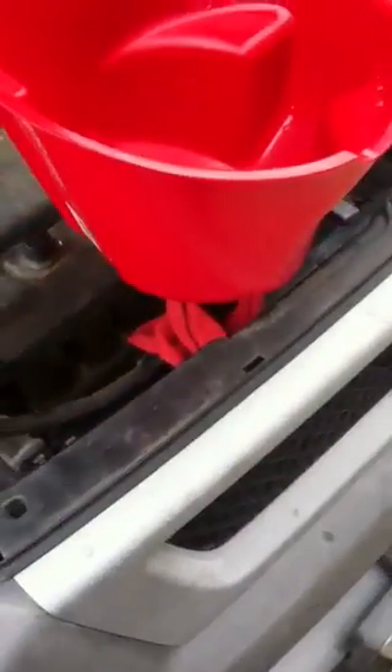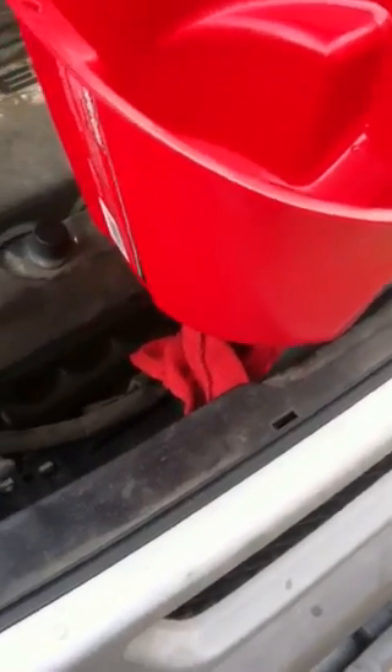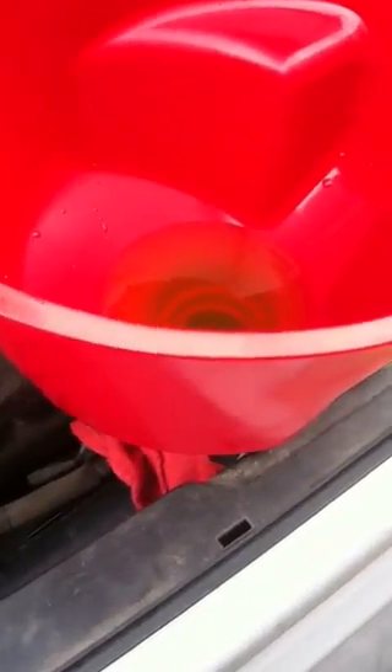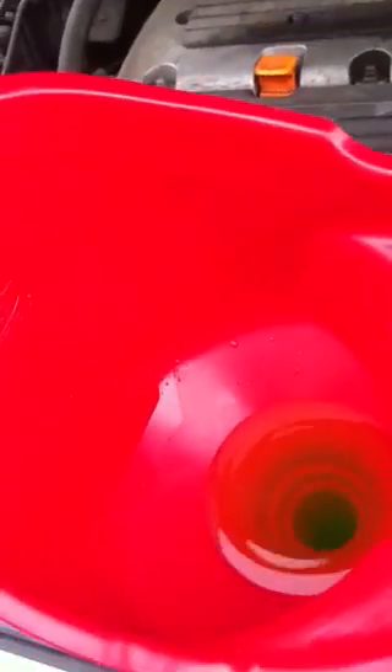120. We're going to hit it again, keeping my fingers free of that fan. 120. I really wouldn't suggest doing this unless you feel really, really comfortable. Hit the button twice in a couple different locations. We're still at 120.5 degrees. And seeing that this is not the proper bleed funnel — we can use it as a bleed funnel — it's not the proper one, so I just got this rag around it, keeping an eye on it to make sure this thing doesn't melt. People use pop bottles, Fiji bottles, and stuff like that, but you got to be careful because sometimes the things are melting on you.